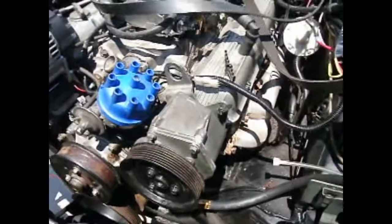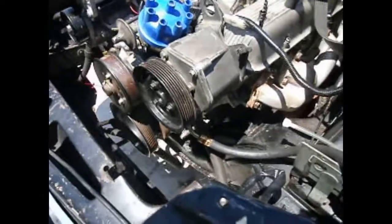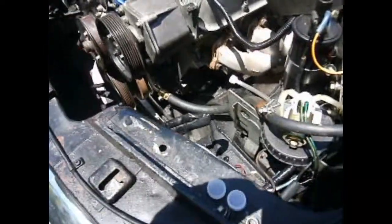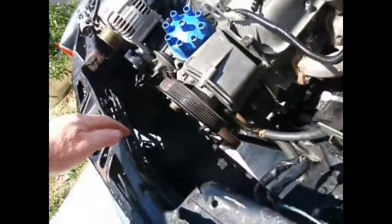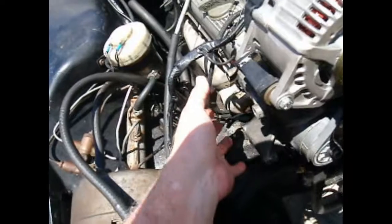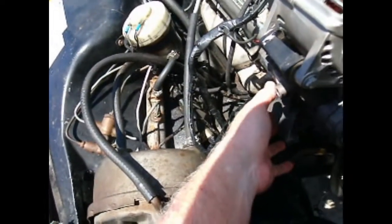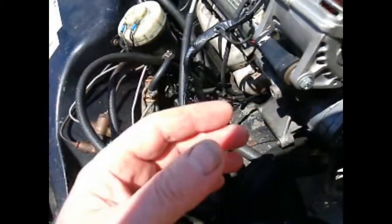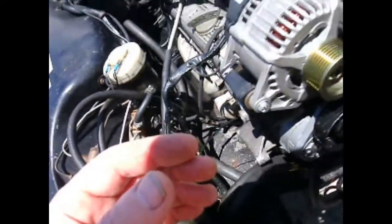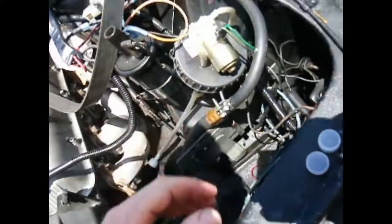I decided that while we were doing the engine swap and all the rest, we would upgrade the air conditioning in the Rover. So you can see the radiators are out already with the serpentine belt conversion. This is the mount for the air conditioning compressor, so I could put a modern compressor on, which would require the R134 Freon. So everything else is out of the car right now, with the exception of the evaporator.